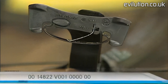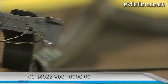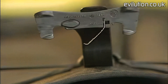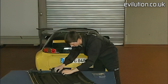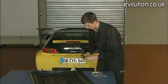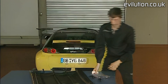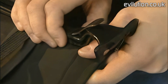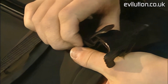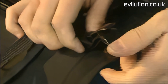On the soft top, exchange the broken slide. The repair set with four new slides is available from the number on your screen. Always use the whole set. Proceed carefully with the exchange — the slides are fastened to the soft top with plastic molding plates, and these can easily break. Hold the slide and push it out of the mounting plate. In this way, all slides can be taken off and replaced.